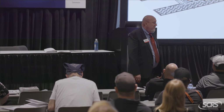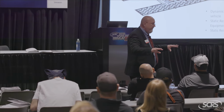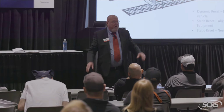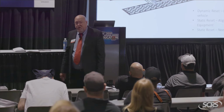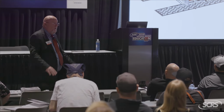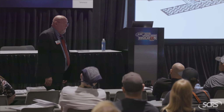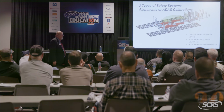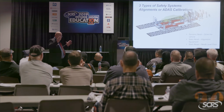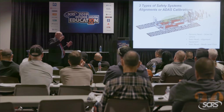I have a brother-in-law who worked in concrete, and when they pour these large slabs like you have in your facilities, repair facilities and dealerships and so forth, they float them out to look good. There could be an inch of fall-off in 150 inches, and you would never know it. The middle of your shop might even be a soup dish, and again, you'll never know it. So the floor has to be level, because you're leveling those boards. Those boards have spirit levels to level them, forward and back, and side to side, okay?